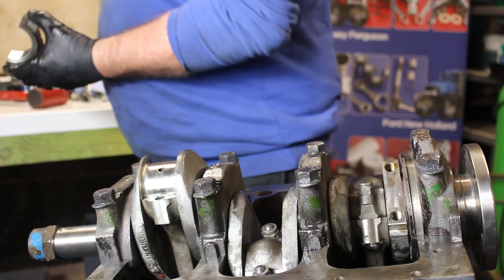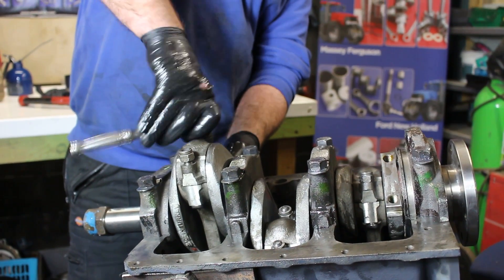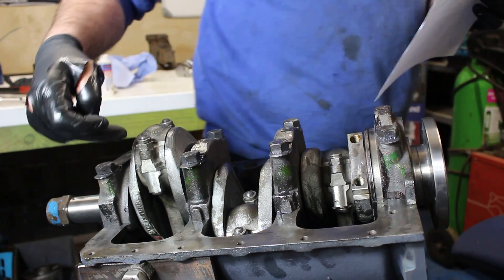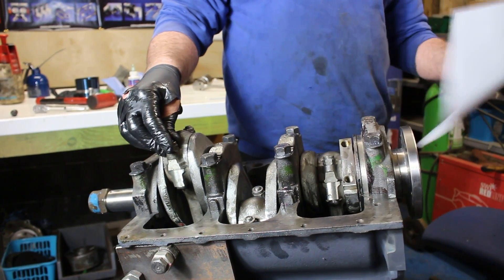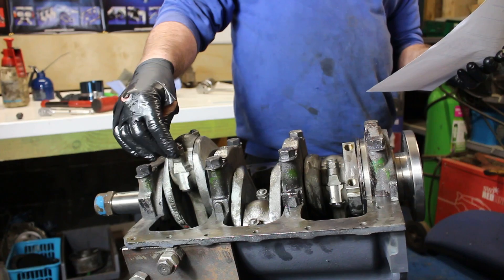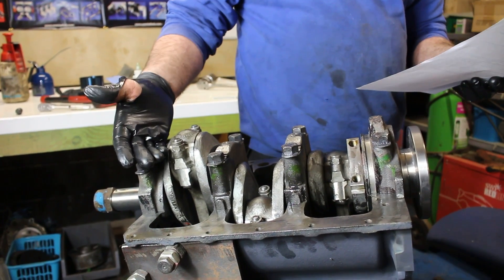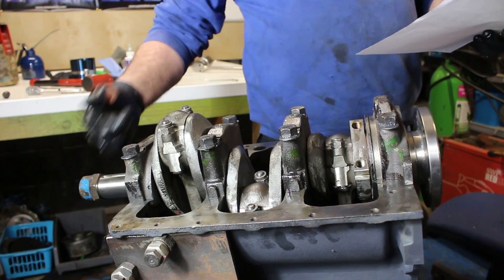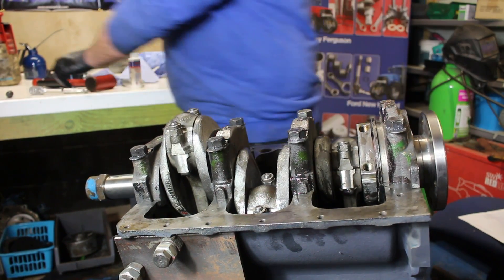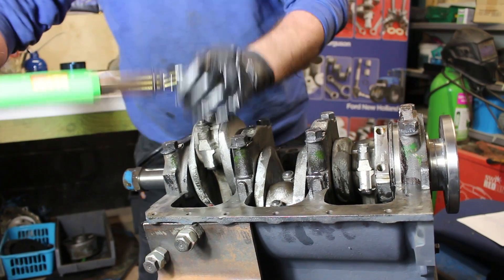There we go — just gently pulling these down, all just gently nipped up. We've got to torque these down to 55 foot-pounds. You can get different types of nuts — these silver ones, I think they're called cadmium. Some others you can get phosphate black. If they're the cadmium ones — the silver ones — torque them down to 55 foot-pounds; if it's the black ones, down to 70. That's what it says in the book. What I'm going to do is torque these down in stages. I'll do them all at 30 first, just to start — a little bit at a time.